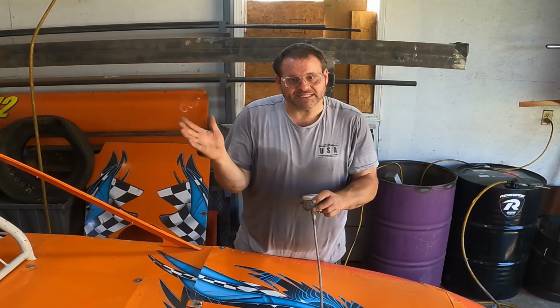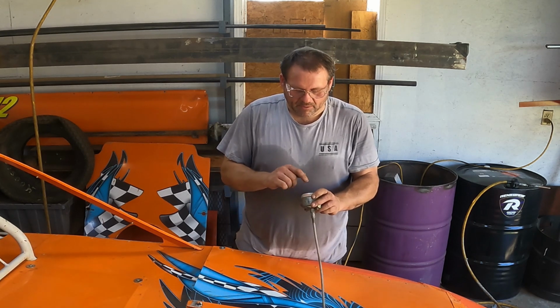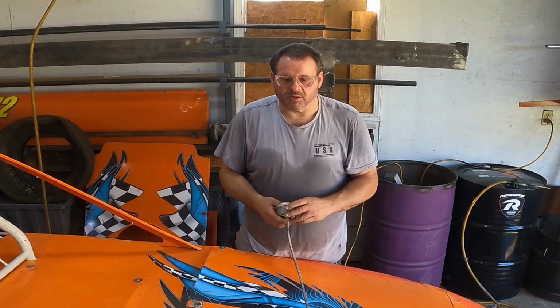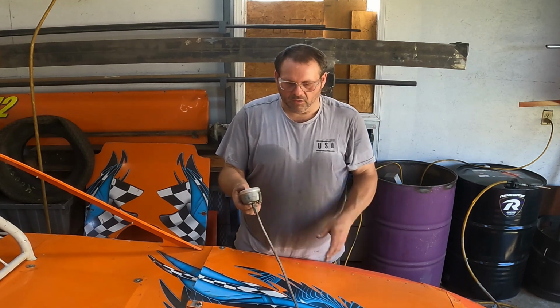And that makes sense too, because it's an 11-pound pump, so 9 pounds is probably just right in there. It was feeding fuel to the carburetor, and that was showing me I was just a little past 9 pounds idling on that pump. So that makes a lot more sense. I'm like, oh yeah, that number makes sense now with me just having that screw screwed all the way in, holding that regulator tight.